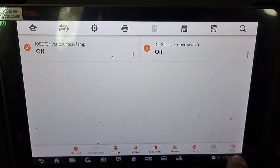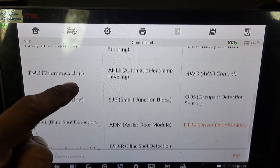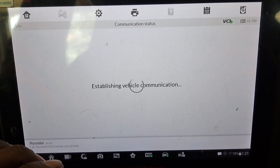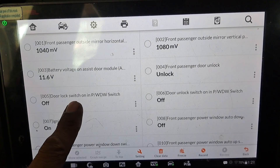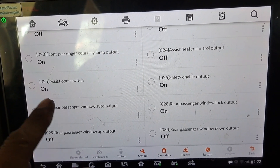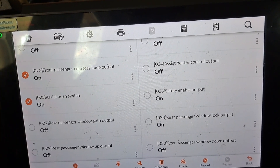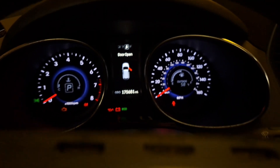The little car icon reflects the door state. Now let's go into the passenger side. We've got the driver door module, and it's going to be in the assist door module — the passenger side — with a lot of data. We should be able to go down to the same parameters. There's the door lock switch. The courtesy lamp parameters are stuck on, whereas in comparison the driver door needs to be in the off state — and this is why we have an illuminating door jar light.